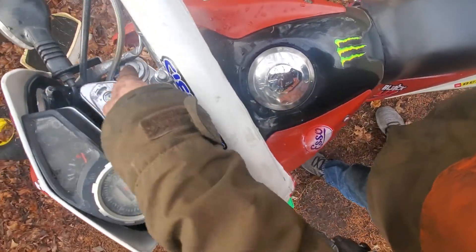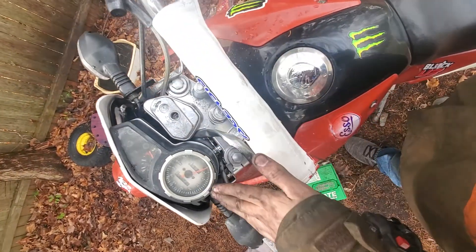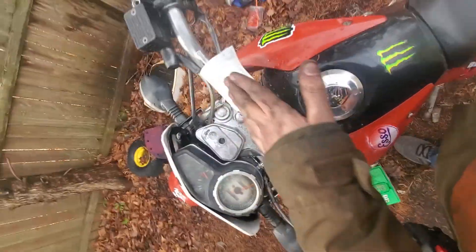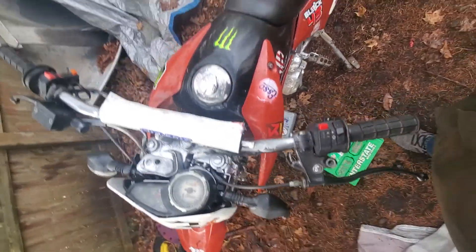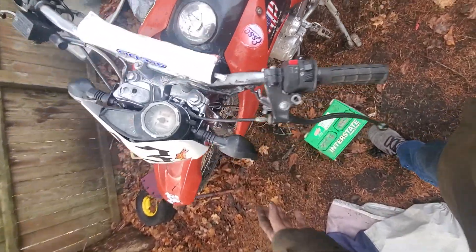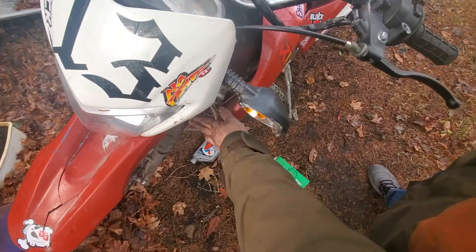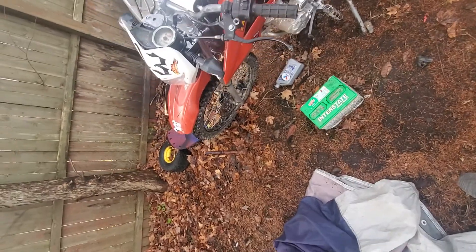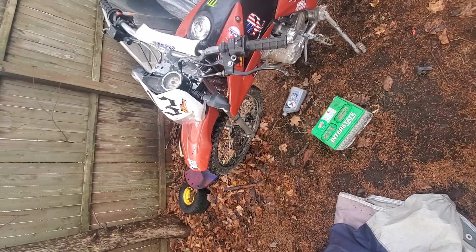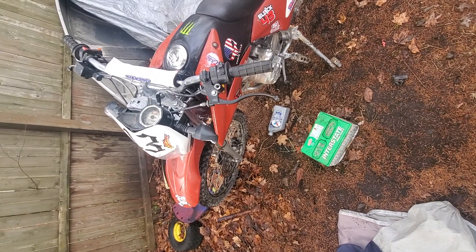If it's really messed up, you're gonna have to loosen these top ones up here. If you start loosening these, make sure you tighten them back down to where they were — tight. I've done this before and it scared me because these are the only ones connecting your forks to your triple tree at that point. So yeah, it's pretty simple — just give it a good push, use your eyes, and take a look at it.